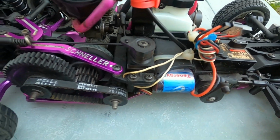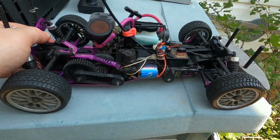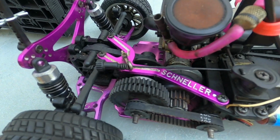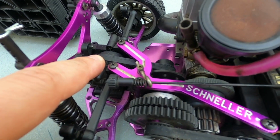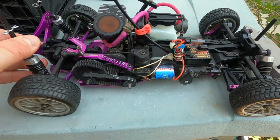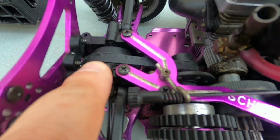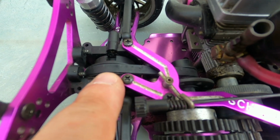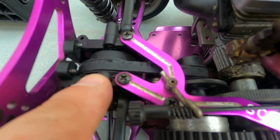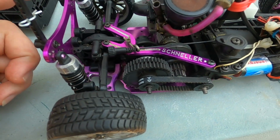Very good receiver packs. Now it rolls, I would say, okay, but there is a little bit of belt friction. Keep in mind, I went through all of the pulleys with this belt system and I pulled out about 4 pebbles from the belts. It still has some friction, but if you take a close look at the belt here, there are abrasions and the belt is frayed. That's usually because it's old, and over time little pebbles get into the pulley and destroy the belt.